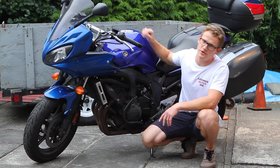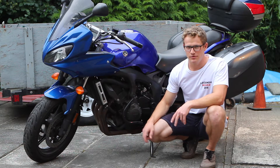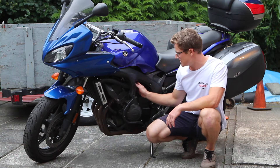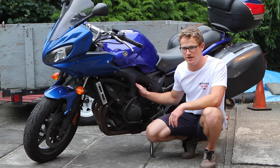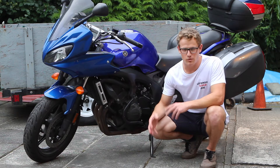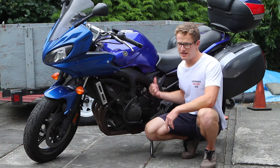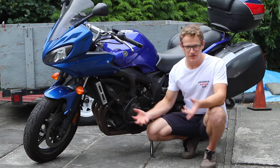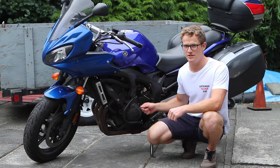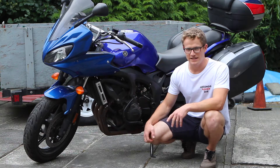Today I'm going to walk you through the entire process. First things first when you're checking your charging system, you have to check that all your fuses are in line and working. After you check your fuses, you check the battery. Then it's the stator, which is under this housing here, with wiring leads under the tank. Then you check your regulator and rectifier, which is under the seat. Finally you check the wiring — making sure you have continuity between all connection points and don't have a short to ground, a broken wire, or something of that sort.